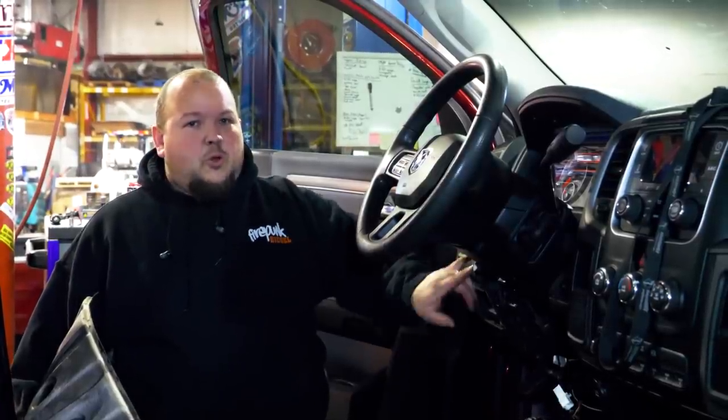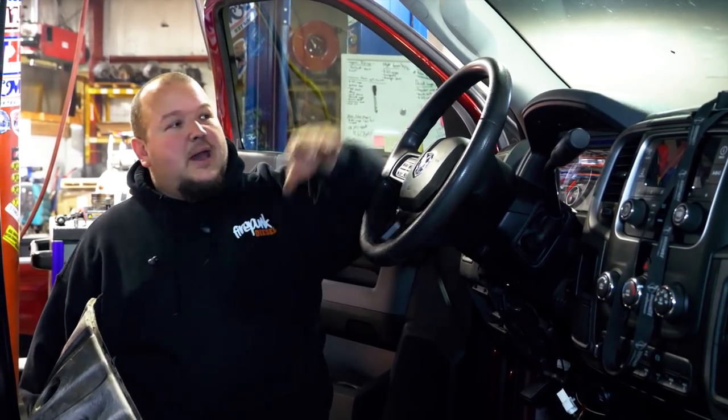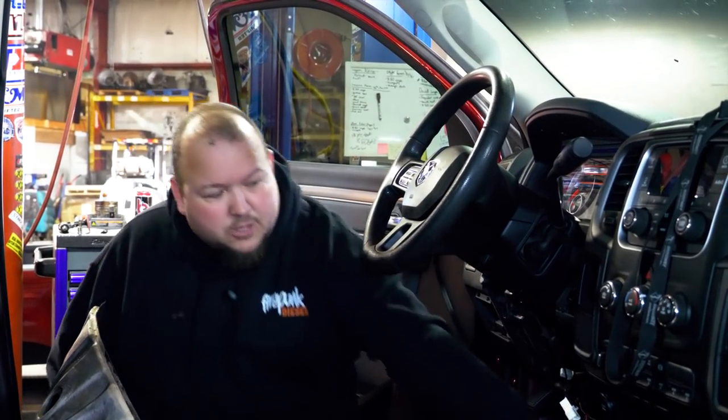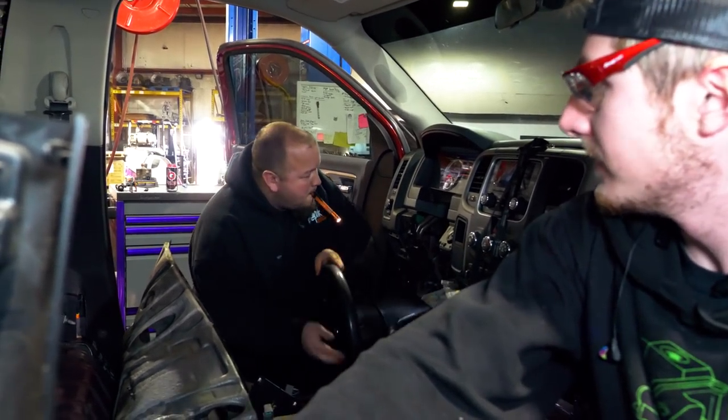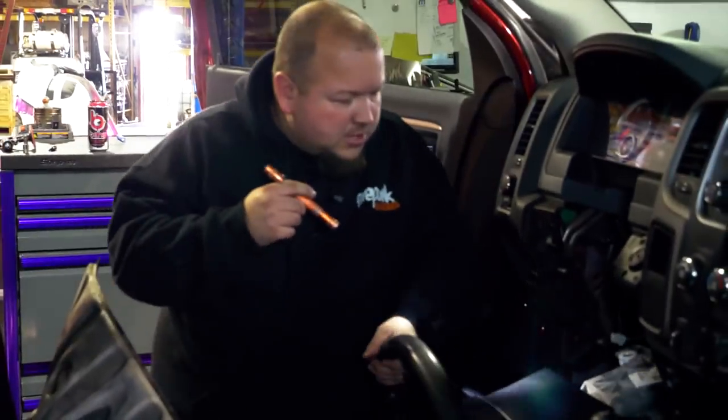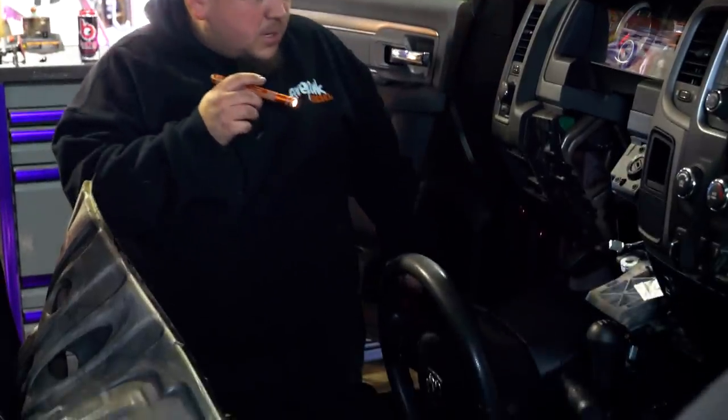There's a handful of wire connections you have to take loose. Most of it's pretty self-explanatory — the connectors are all pretty visible and easy to get to. Get all those wires loose and then the whole steering column drops down. Once the steering column is down, there are two more bolts up underneath that you need to get to take the dash loose. So three bolts on each side, two up at the windshield, the four on the steering column, the two behind it, and then it should fall out. Ghost ride it, baby — just leave the steering wheel sitting there and the dash should pop right out.